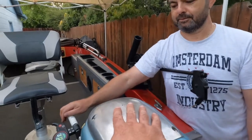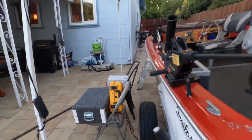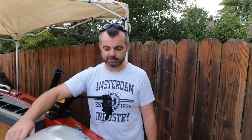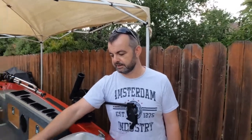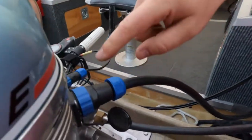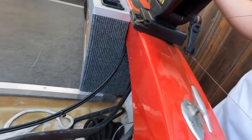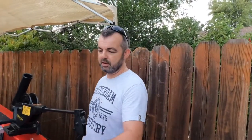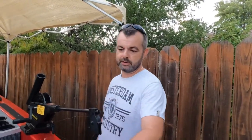The original motor didn't have a reverse, but being electric, this does — so we have both forward and reverse. The motor has its own battery backup, however the main power comes in via a cable so you can connect an external motor controller for a much more powerful battery setup and take advantage of the full 1,000 watts. Inside is a 500-watt controller for internal battery use, but externally connected you can send three-phase power and run at full 1,000 watts.